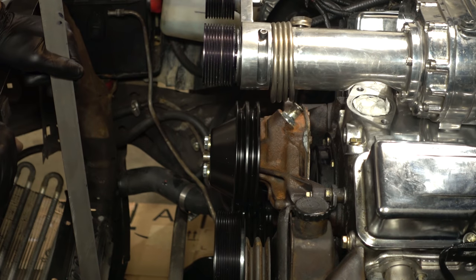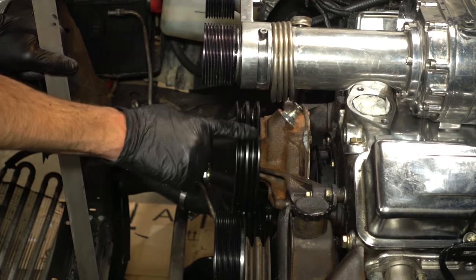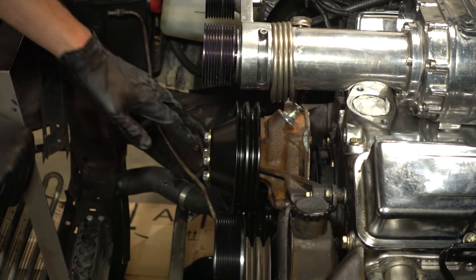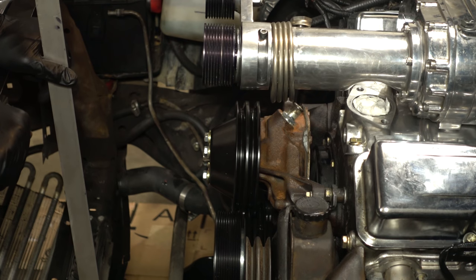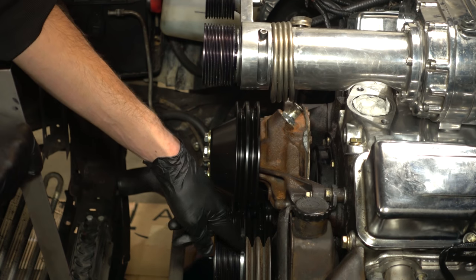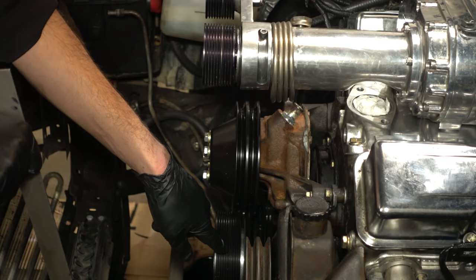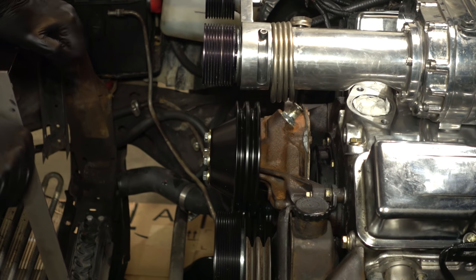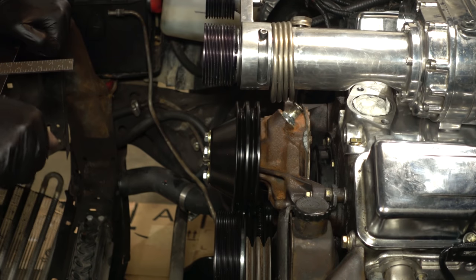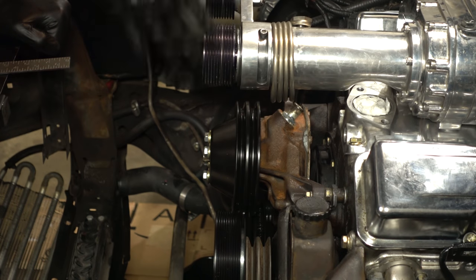I've already had to think about this, and here's what I'm going to do. I don't want to mess with this because I'm going to lose my mind — I like this pulley because it looks nice and it's installed, and I already modified the alternator brackets. I think I'm going to set up the pulleys the way I had planned: with an eighth inch spacer behind the pulley, I need another seven eighths of an inch spacer between the adapter and the pulley. I'll leave these pulleys on and just put that together as planned, and probably change it later. I was hoping this would be a moment of victory having this thing installed, but it's just another defeat and another lesson learned. I'll find the spacers, order them, and hopefully then everything works.